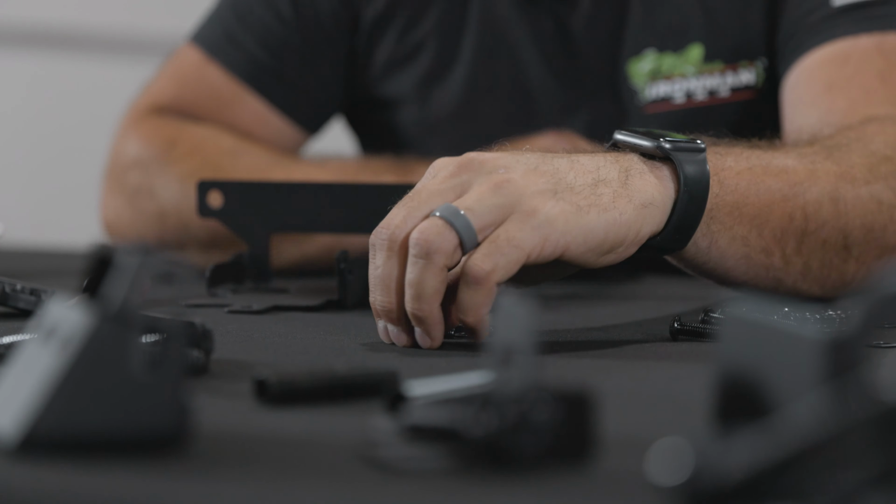All right, we got 2 connectors we have to undo. This is the fiber optic for the front camera, and underneath it is the sprayer for the camera. So pretty simple. Press down on that little brown tab, and if you can't do it, use a screwdriver. There we go. Push down hard, so that's disconnected. This one, you squeeze both sides in and it flares out, and then you can pop that out. Now that might leak a little bit of fluid, but it's just windshield wiper fluid, so no big deal.